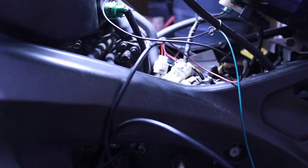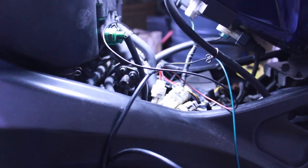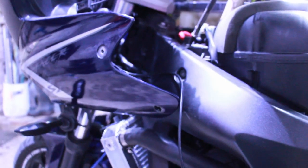Fantastic, right. But for testing the sensor, so the speedo sensor, if I rotate the wheel now, it should look like a rotating wheel. Yes, good. Fine, so the next thing to do is now see if we can get an RPM signal from the grey wire over there. And then if that does work, we will wire those in properly, pin them in, cut the wires to length, pin them into the loom, and then obviously run this loom through the chassis, put a plug here, and then be closer to what we want to do.